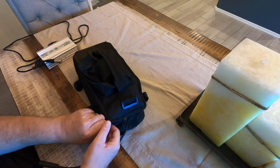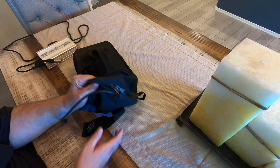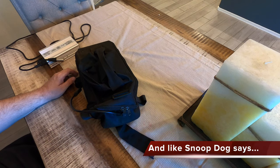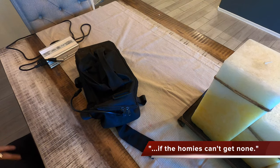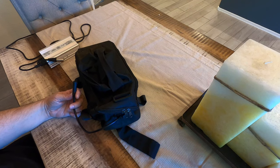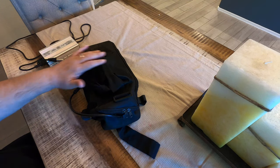Once you put it back on the trike, there's a handle and two Velcro straps on each side that strap onto the trike. I highly recommend getting the higher capacity battery because you'll have a lot more fun with it — you don't want all your fun to stop simply because you run out of juice. Especially on a direct drive motor, once the elements are no longer energized they provide resistance, meaning you're actually fighting the magnets in the wheel. That makes the trike feel much heavier than normal. Get the highest capacity battery you can.